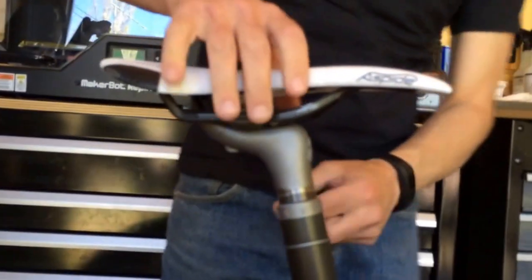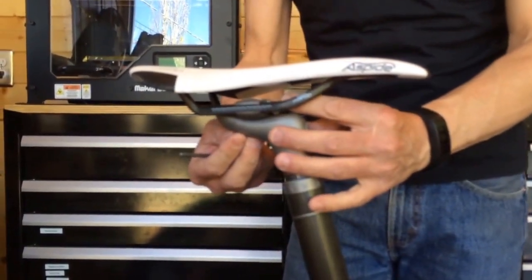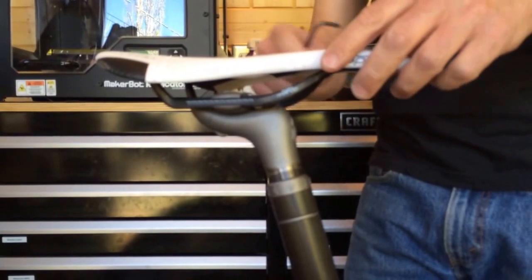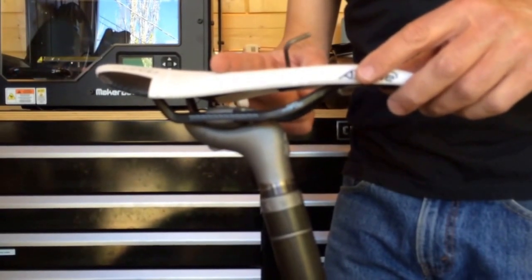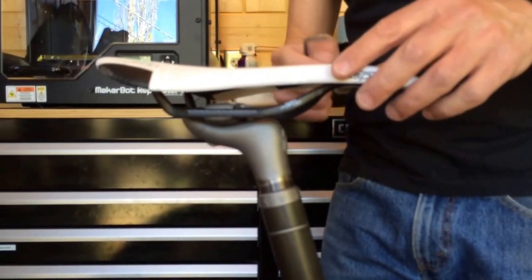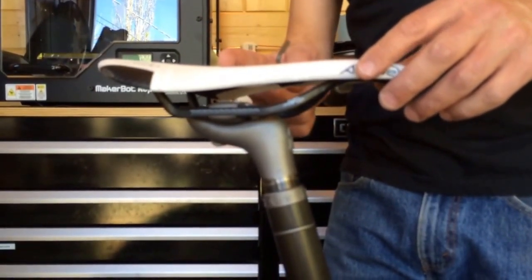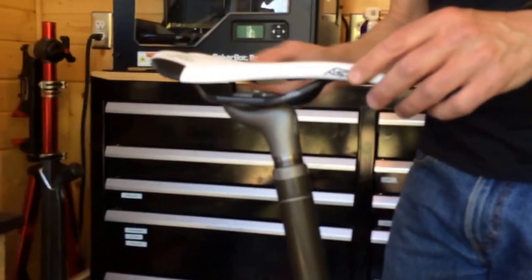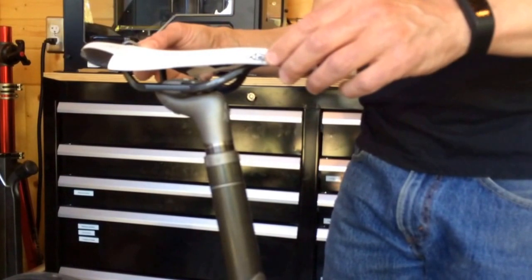Like any two-bolt design, you change the angle of the saddle by simultaneously tightening one bolt and adjusting the other. What's different about the micro-adjusting saddle mount is that it pivots over what I call a neutral pivot design — the center point of the pivot for the saddle is up here at the top. This is to isolate as much as possible changes in angle from any accompanying change in height. Because it's a two-bolt design, you can change the angle of the saddle without changing the fore-aft position on the rails, and vice versa.